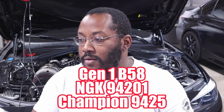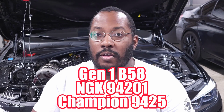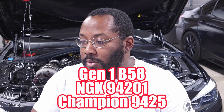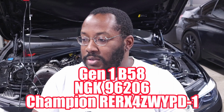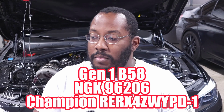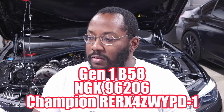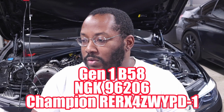So for Gen 1, your options are the NGK 94201 or the Champion 9425. Those are the 2 spark plug options that you could potentially get if you buy that OEM BMW part number. On the Gen 2, the NGK option is 96206. And then the Champion, unfortunately, it looks like it might have been discontinued. Some of you might have pulled Champions out of your car, but it seems like they might not be using it anymore. But I'll also include the part number on here. It's a very unique part number, so if you want to order the Champion versions, you can do that as well.